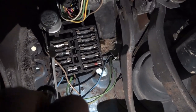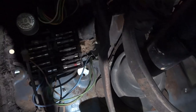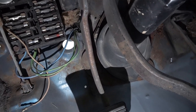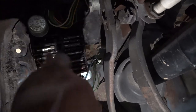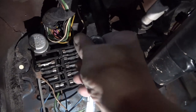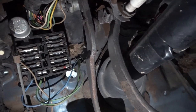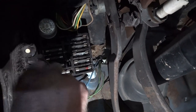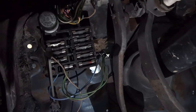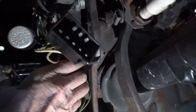I'll also be replacing the wire harness. To remove the wire harness, you have to unbolt and unscrew a number of items underneath, including the fuse box, which I'm doing here — that's one of the very first things you've got to get out of there, and it's held in by two bolts. As you can see, I'm removing those. It's not easy access, but pretty easy to undo everything once the cluster is out.